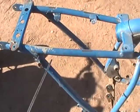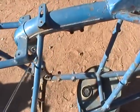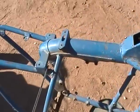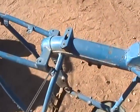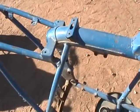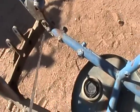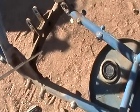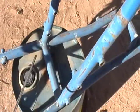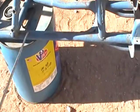We're going to put a gusset right in this area here on both sides, another one right down in the corner, and another one right in this corner here too. This area here doesn't really need to be gusseted because it's connected right. Moving down to the bottom — on the 87s you're gonna want to put a gusset in the corner right here on both sides. On the 88 to 90s, there's some webbing right here that's already done from the factory, so you don't need to do anything there. Also right here, put a little gusset in this corner, another little gusset in this corner, and a little gusset in this corner right here.